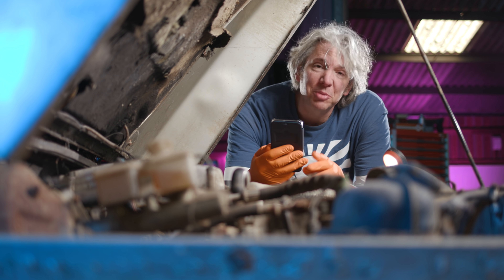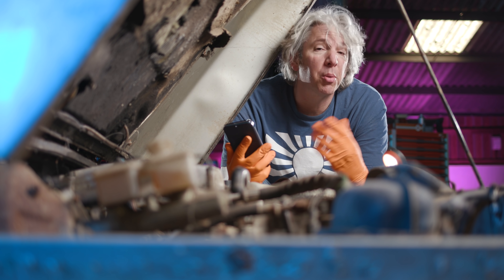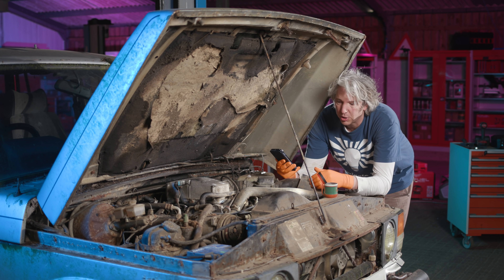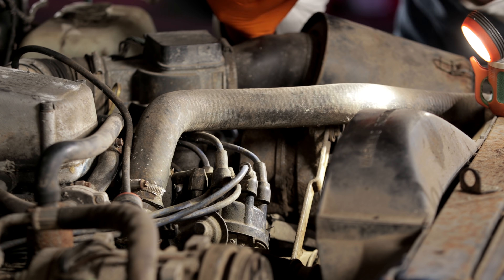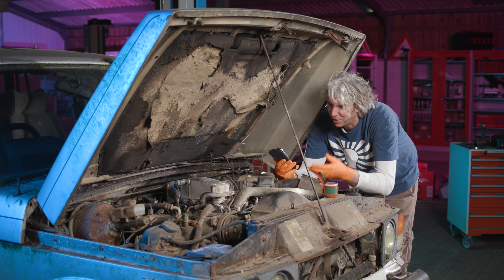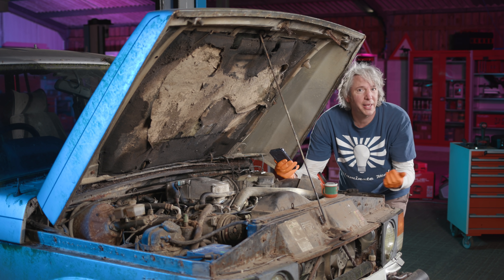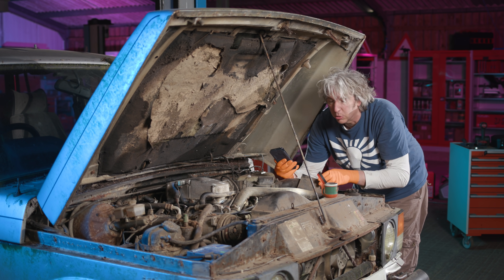To answer the next question I need to be in the engine bay. We've had several comments on this — from Music Is My Therapy: surprised the oil wasn't checked and changed. That's a fair point. It's obviously ideal to change your oil once it's warm, but when you're trying to start a car that's been standing around this long, first check it has oil, then before you crank it over you want to make sure you're going to get good oil pressure. On a petrol engine like this, you could take off the king lead off the distributor to make sure you haven't got any sparks, then crank it over until the oil pressure light on the dash goes out. Now on this particular engine there's a really nice way of getting the oil pressure up before you start anything at all — but for that I need to take the distributor out.